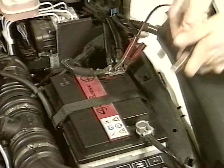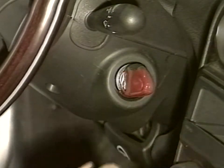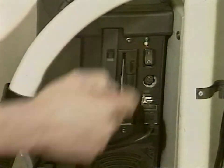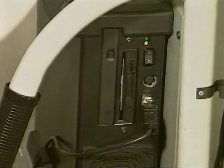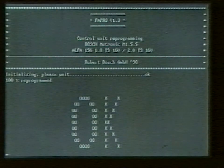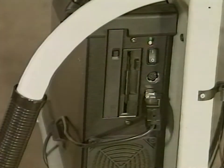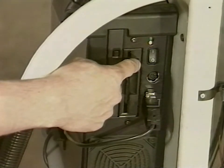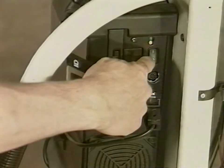Only supply the equipment with a car battery. Place the start key on start. Insert the reprogramming disk and switch the examiner on. Wait for about 3 minutes and remove the disk after OK is displayed. Switch the examiner off.